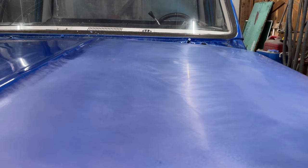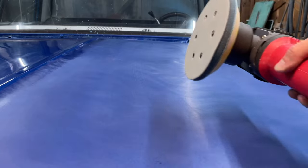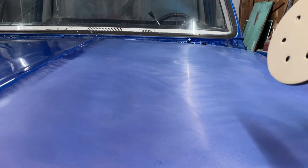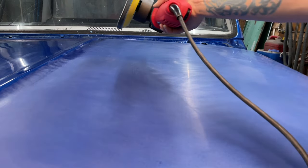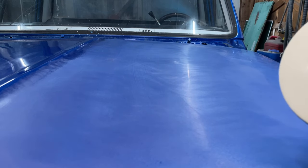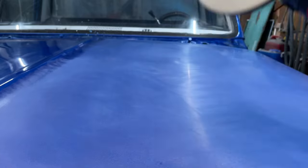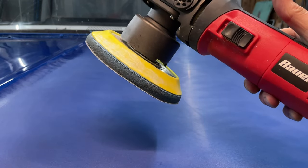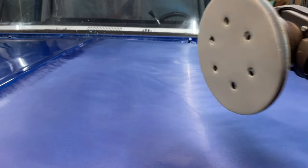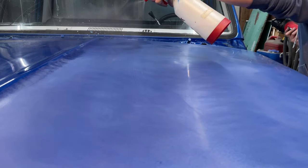I've got you pretty close and personal now with the 1000 grit job. You can see the cross hatch. There are definitely a lot of 1000 grit sand marks in there. You can see where I didn't get too close up in here. I didn't want to really spend too much time in grooves. I'm just trying to get the most of it looking really, really good. Here's the sandpaper I'm going to be using. Here is the, it's an inexpensive Harbor Freight polisher DA. And I'm just going to keep everything nice and wet.